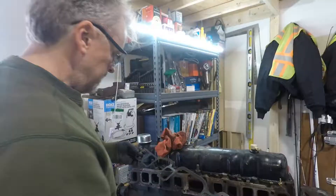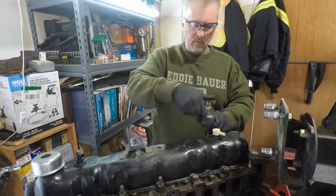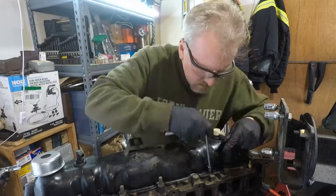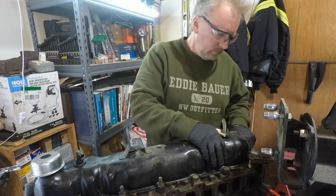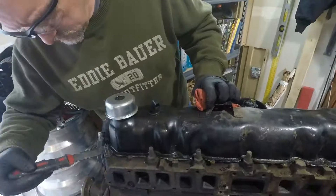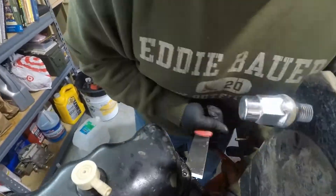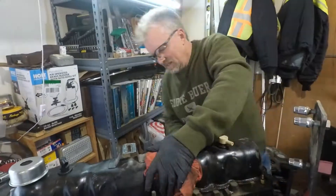It has a valve there — we may remove that valve. We're going to remove the valve cover; I want to take a look at the valve train. This particular one was leaking pretty bad about a year ago, so I went ahead and straightened it out and reinstalled it to stop the leaks. I used a good silicone. Oftentimes these stamped steel valve covers are over-tightened and they warp and won't seal very well, so make sure you don't over-tighten it and make sure you straighten it out — hammer it flat before you reinstall it.